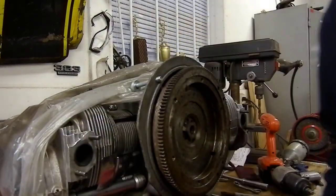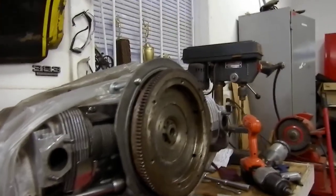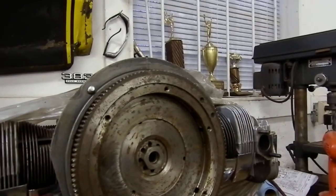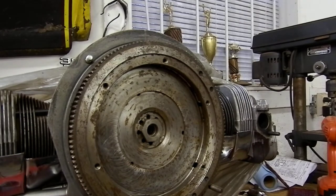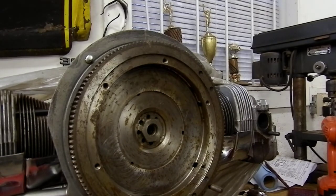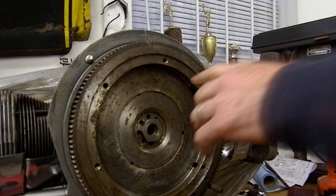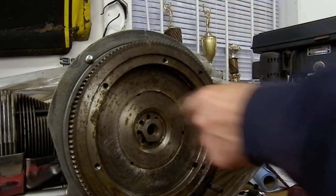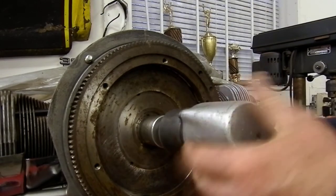I'm going to remove what's called the gland nut — that holds the flywheel onto the crankshaft. On this one there are a bunch of holes in behind the gland nut. What I've done is used a fixture and drilled the flywheel out to an eight-dowel pattern and drilled the crankshaft to eight dowels as well. That allows for a stronger bite as opposed to just having four, because when you increase horsepower these engines can shear them off very easily and ruin the crankshaft.